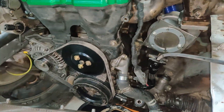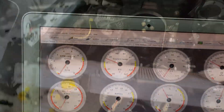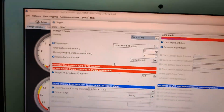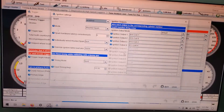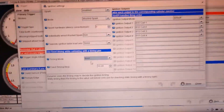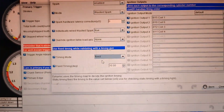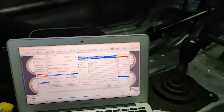In my case it's about 180 degrees, so I put that in TunerStudio and it ran. You will still need a timing light to determine base timing, but that at least gets your engine running. In TunerStudio I'm opening up my trigger settings to adjust the trigger advance, and in ignition settings I'm setting the timing to fixed timing. If you have a direct TDC mark set this to zero.